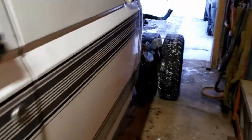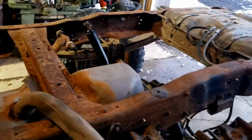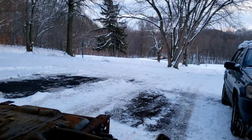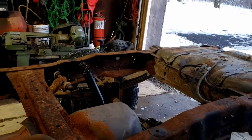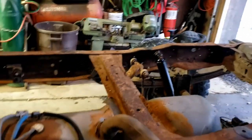Got brakes all adjusted up. Got our rear wheels back on. Got it down on the ground and just driving it around the driveway here a little bit. Brakes were just not right. It was like I had no vacuum assist at all. It was like the booster was bad or something. So,